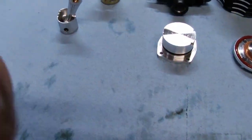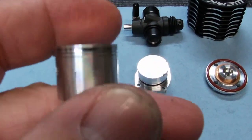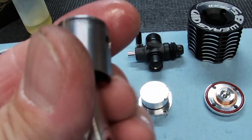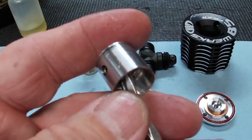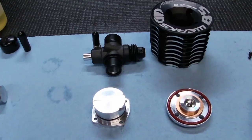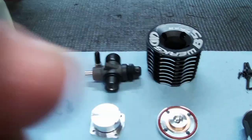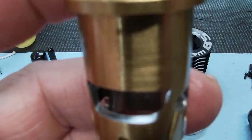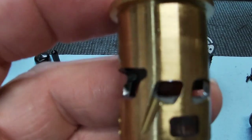There's a lot of meat on there. The piston is an alloy aluminum piston with a razor knife-edged rod. There's still some restriction — it could be in the ports. She has a five-port exhaust port, still partially engaged around 8,000 RPMs. This is a chrome-plated sleeve.